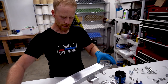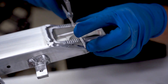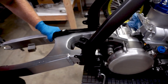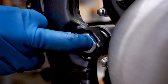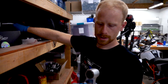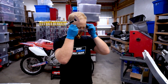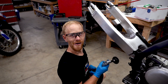I just thought of something as I was looking at the swing arm - the chain adjuster marks right here are a little gouged out, so I'm gonna have to remake some of these. Let's give her another try - there, that's how it should be, right there, buttery. Got our linkage, more brushed aluminum. We gotta do some more trimming here for the linkage - it's a little too tight with that powder coat so we're gonna have to grind it down just a little bit.